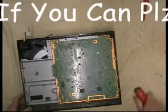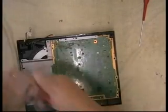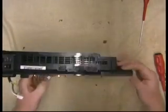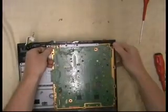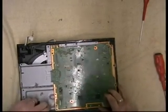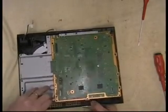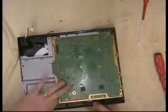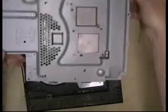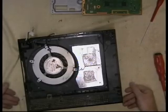This is the first time I've taken an 80 gig apart. I'm going with the fact that we've got to take that screw out next. Okay, that's freed that bit up. Right. Yeah. Right, that was the heatsink paste. I just grabbed it. So I can only suggest you pull from that side to free it up. Lift the whole mech out. Yeah, the heatsink paste has got it. So off with the board to reveal the spanky new fan assembly.